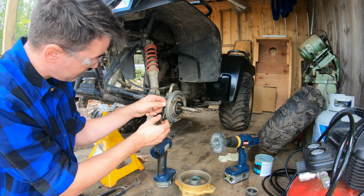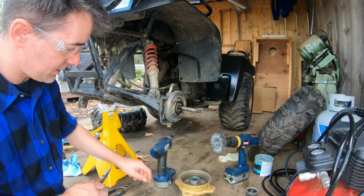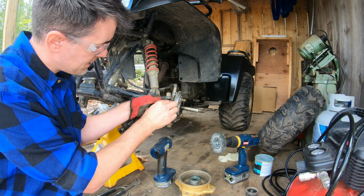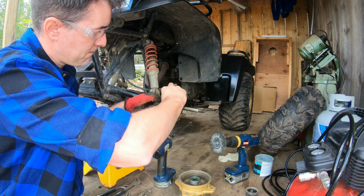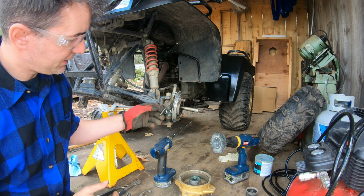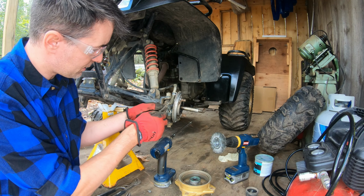And then I'm gonna get my boot on. Get my E-clip back on. Turn the axle so you can see a little bit here. Feed the big spring back up, hold it back as best I can there so I can get this guy over the cable, sits down, ta-da. I did put a little bit of that anti-corrosion grease on the threads here to make my life a little easier when I get there. Then we have our other spring.